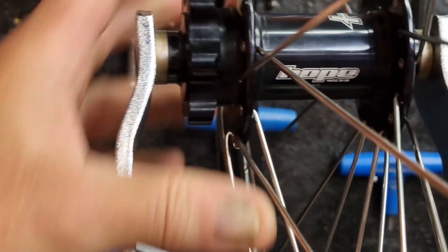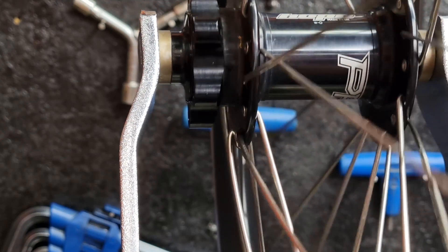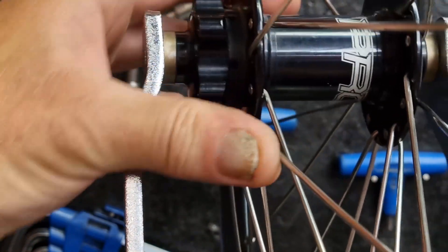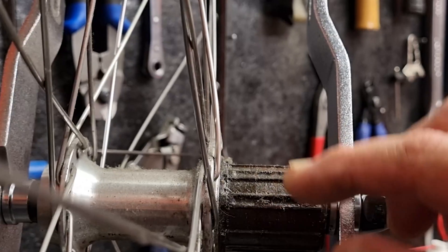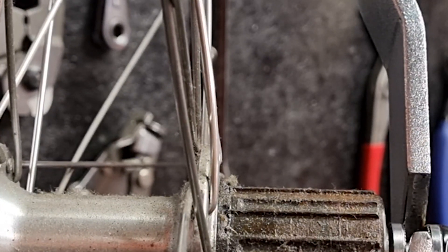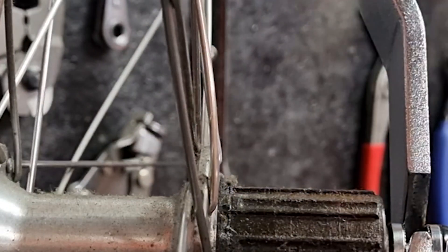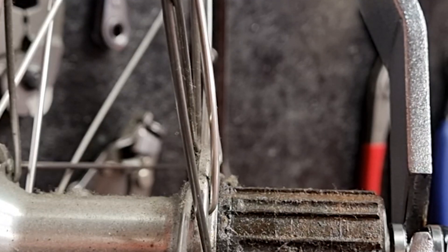When I talk to people about wheels, I always find that everything you do building a wheel is really important. This is one of those things that doesn't take much skill but makes a massive difference to how strong the wheel is and what the spoke tension is like. This is a spoke I've just put in — it's an outboard one and you can see it's really curved out. What we need to do is bed that in so it's nice and straight, taking a much straighter route from the hub to the rim.